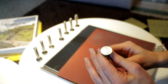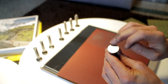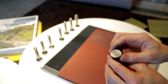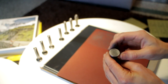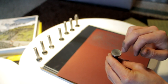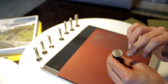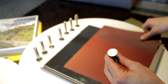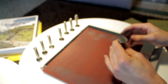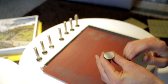The surface is starting to get some uniformity. When I turn it into the light — it's really difficult to see on video — but I can see there are some grooves in the center piece while the rest is really uniform, nice and flat. I'll need a little bit more sanding but I'm going to switch from the 320 grit to 600 grit and do exactly the same thing until all the grooves are gone and we have one flat lifter surface.